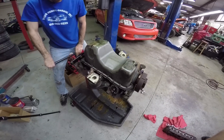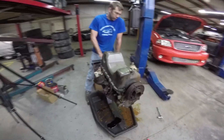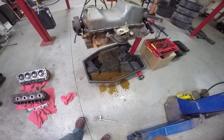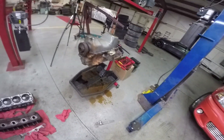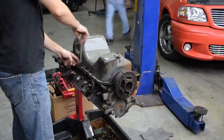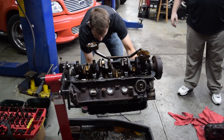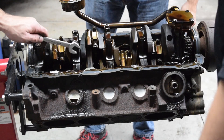Bruce just said we were going about this the hard way. It barfed everywhere with rusty water. Now that we have the bottom off — now the top off, now the bottom off — we're taking the oil pump and sump off and then the connecting rods, which are all numbered on the inside so you can't mess them up: one, two, three, four.